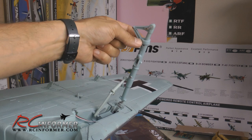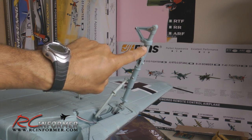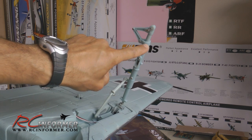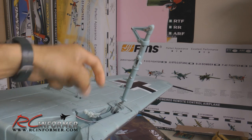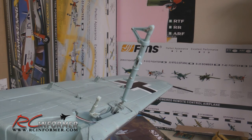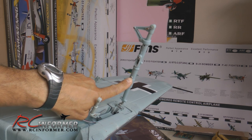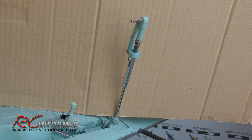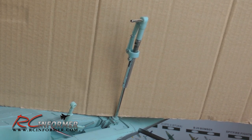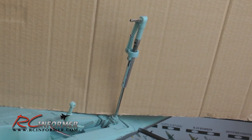Now what that does is expose one of the problems that you really couldn't see before. You can see there's actually a set screw in there that's probably either missing or very, very loose. The next step is to pop this linkage off, and this is just a dummy over-center linkage that's just there for appearance. And then lastly, you want to remove this screw right here with a Phillips head screwdriver. As you can see here, after removing just five screws and one E-ring, the retaining ring that was keeping the wheel on, you have the strut completely exposed, and it's actually pretty simple.